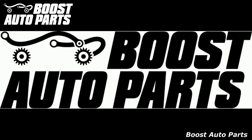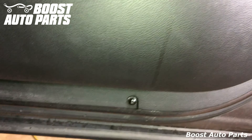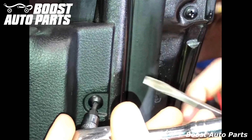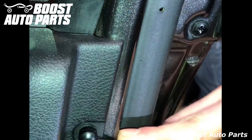To start off with, you need to remove the six body clips around the door — there's one here, down here, here, here, here, and here. This is a T15 Torx. Just loosen it up a little bit and then get a flat-bladed screwdriver behind it. There'll be a little gap after you loosen it and then you can pull it straight out, just like so.